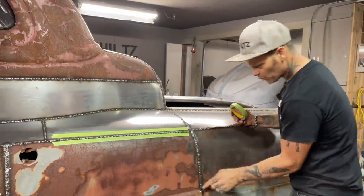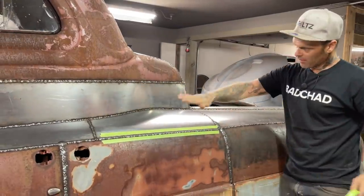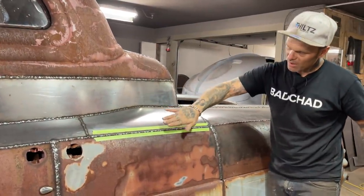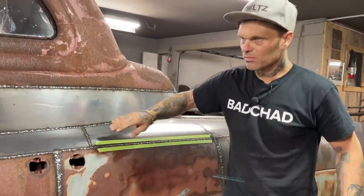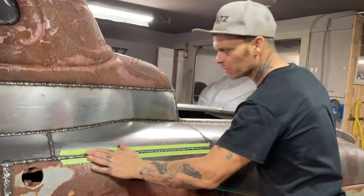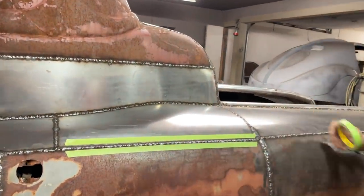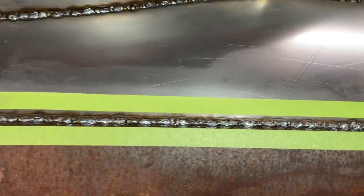It's beautiful. We would just grind the welds, and we grind the top off. We grind it flat to this one because we know we've got to weld it, and we angle it down to this one because we know we're laying over top of it. If we can grind it down to an 1/8 or a little less than an 1/8 from the weld, we're perfect to go. But we would not grind this or this to fix that. And we've got it all down tight, and that's the way it should be ground.